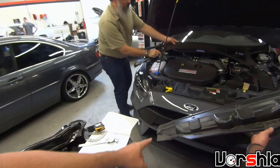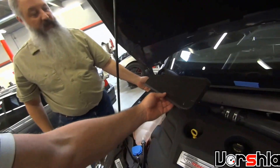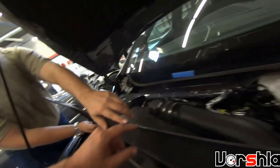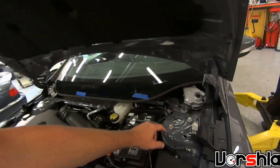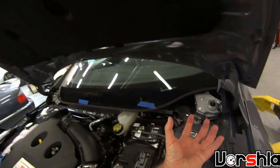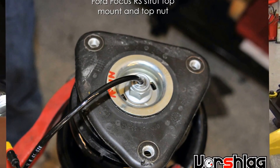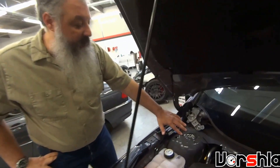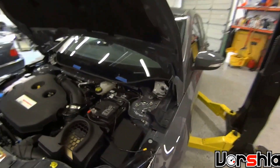Above that was this rain tray — it looks like a fiberglass piece — and above the rain tray was a weatherproof cover with little speaker grills that pop in place. To get access to the strut top, all of this comes off, wipers come off, and this channel clips in — it was a real challenge to remove too. The packaging underneath the hood of this car is pretty tight. Unlike most cars, the strut top mount actually has a bolt that goes through the top, so you've got to line it up in the tower underneath this massive strut tower brace, which covers everything visually. You have to line up these three bolts. So if we made a camber plate, it's going to have three studs that'll come through and you'll have to put the strut tower brace on top of that. Even though there are places for a locating pin, they didn't put a locating pin on the top mount — that's strange. So putting struts in and out of these cars is going to be a challenge because of the way they mount it, kind of backwards.